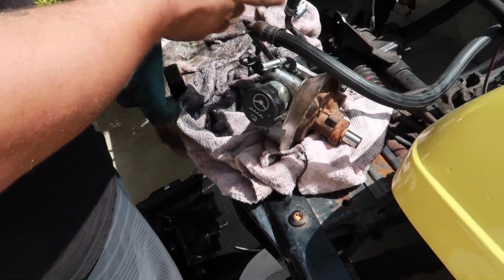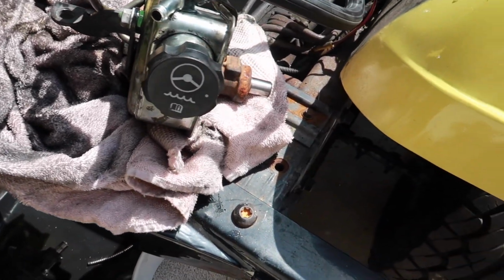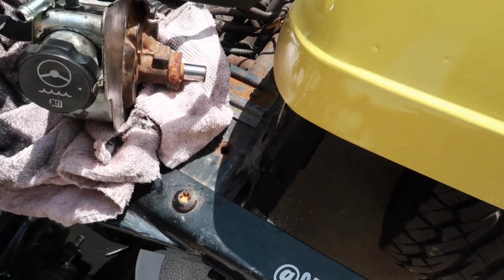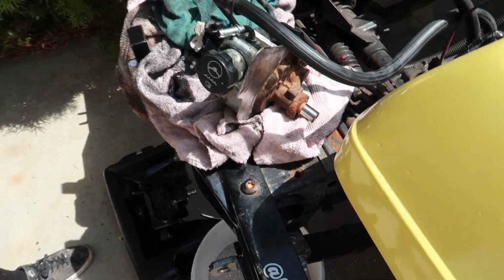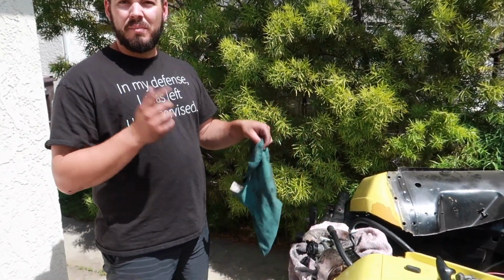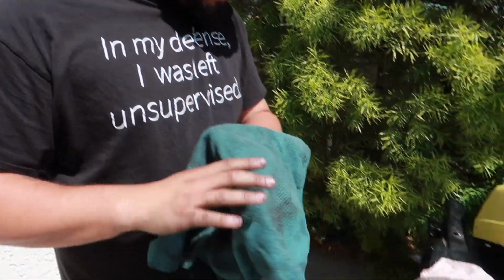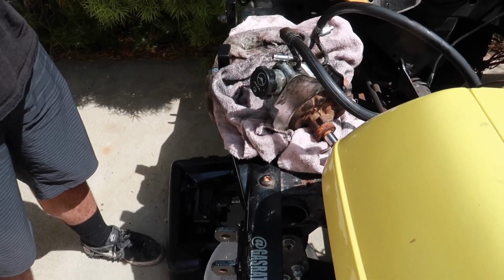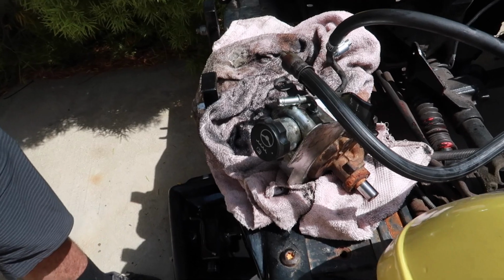So a little fancy hose clamp work, and that'll work, dude. I think that's the high pressure line, and it's just a return, so the return will be fine. With that, that'll be ready to go. We get the front drive together, bolt the motor to the trans, and hope with the spacer kit and everything that it's all going to line up the way we want it to. We don't need to mount it because we know it's going to fit, from the donor motor.